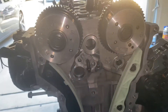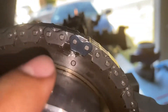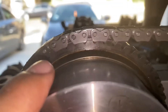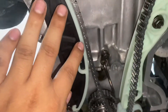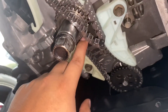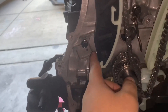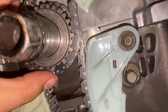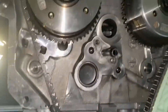I'm gonna get everything set up and show you how I did it. That mark is lined up with that, I put a little tension on it, and then that mark is lined up with that. Now I'm gonna run the timing chain all the way down to the crank snout and line up this last dimple. Everything lines up correctly, I can leave it there, then I'll get the tensioner, put pressure on it, and lock it in place. That last black mark is lined up with that dot and everything is lined up correctly.